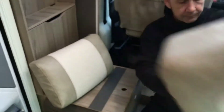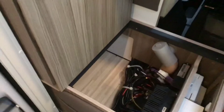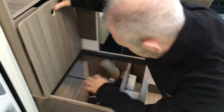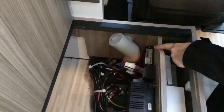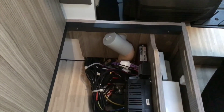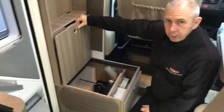You've got your travelling seats and we can move the cushions. Underneath there at the front, by opening the box, is your master fuses and trip switches — just like in any house. Behind is all your other components. However, on the right hand side is the control panel for your solar panel. What's the solar panel doing at the moment? Absolutely nothing, because we're hooked up on the electric.